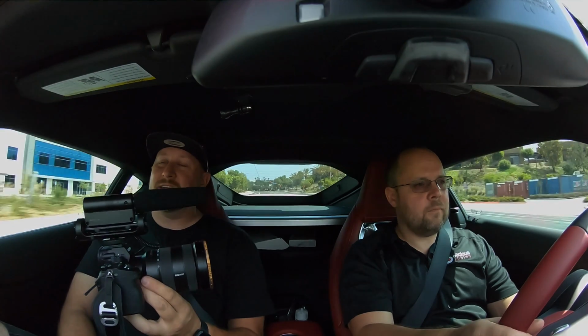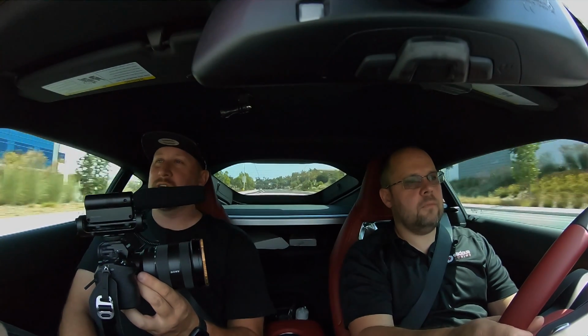We went to 93 octane, like a 93, 94 octane, which you'll see on the East Coast. We're hitting about 380 horsepower, and right now we're on like 100 octane mix, which we really say anything above 97 octane. So that gets you about 400 horsepower, and I think it's like 450 foot-pounds of torque. And so there's different modes like Valet and all the different octanes and stuff we talked about.